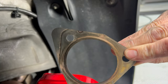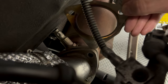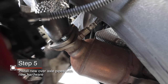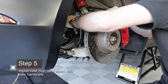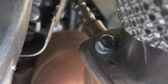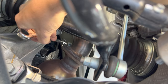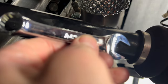About that catalytic converter gasket: on the top left of the gasket is a tab plus a little half-circle cut out of the metal. You need to point the tab down and the half-circle back towards the cat. Install the pipe in the reverse fashion that you pulled it out, making sure you have a bolt handy to pin it in place. Get a couple started and then grab the appropriate tools — socket or wrench — to start to tighten the bolts. On these FabSpeed pipes specifically, the inner bolt closest to the body was so close to the pipe I couldn't fit a socket over it. I tried an open-ended wrench but the body was too close. I ended up going to Harbor Freight and for $14 got a full set of stubby wrenches, and that did the job.